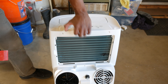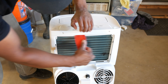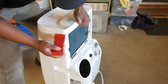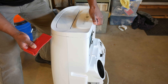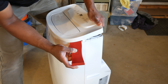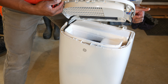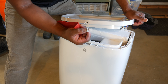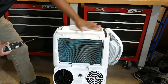To get the top off, you can't just pull it off — you'd probably break something. What I'm going to do is pop that up, keep my fingers in there to hold it open, and do the same thing on this side. There we go, and that comes off. It's a little nerve-wracking, but that's how it comes off. You may want to take this sensor cover off so you don't lose it — just put that in a bag. There are two screws, one here and one here, and then we can separate these two halves of the case.